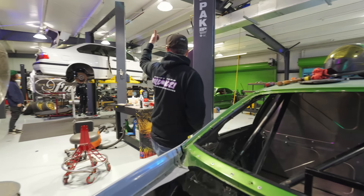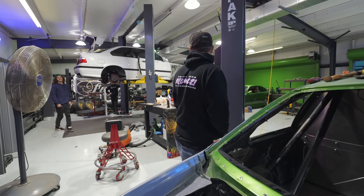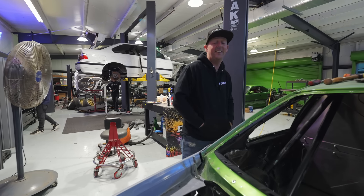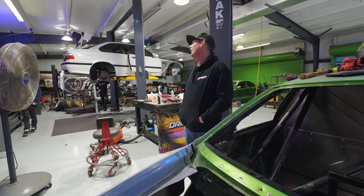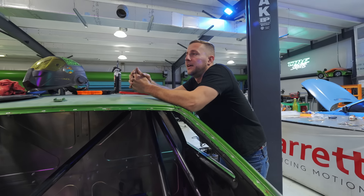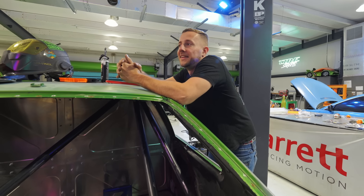We talked him into the biggest radiator he could possibly fit because he hates overheating and we hate him overheating. We like to keep our cars under 200 degrees — that big PWR radiator will do it. A great day at the track is when the only thing you do is fuel up the car and change tires, especially if you don't have to mount and dismount the tires. That's why we like to show up with a bunch of mounted wheels.